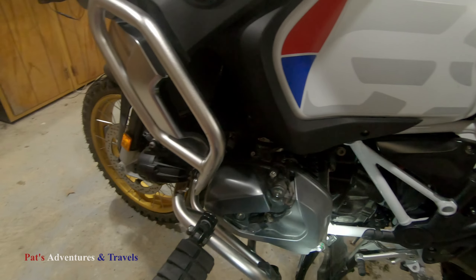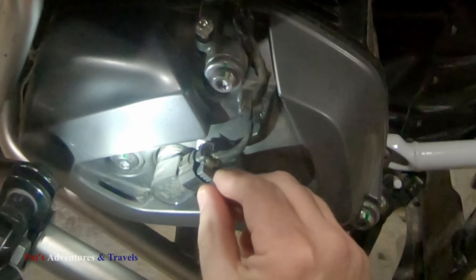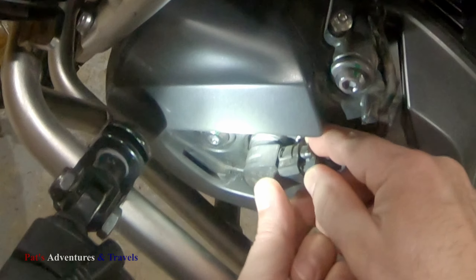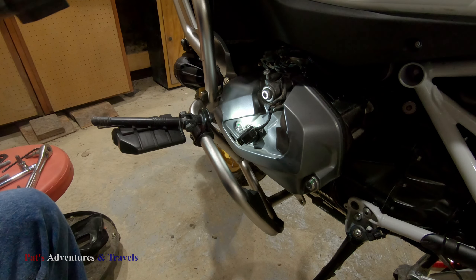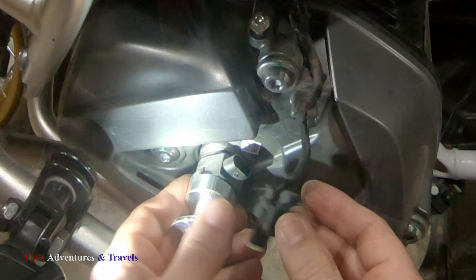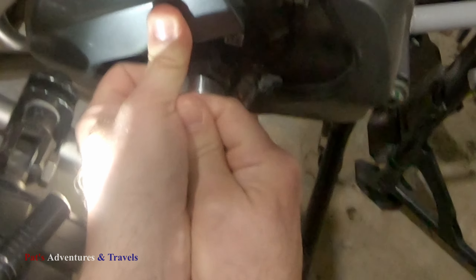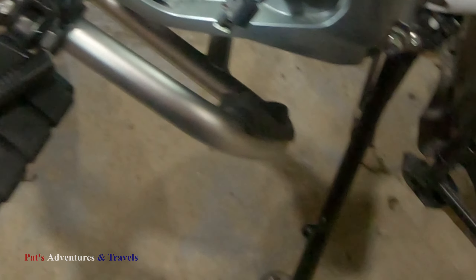Let me shed some light on this. We pull up on this little gray tab here — these are kind of a pain. You squeeze in and it just pulls right up like that, and out it comes. I bought this tool to help remove the coil pack, and that's part of the reason you have to remove it. It just slips in there, and this sucker is in there, and then it finally comes out. Now we'll set this down where it doesn't get dirty.